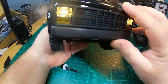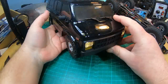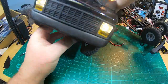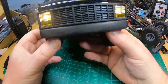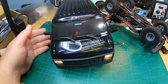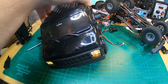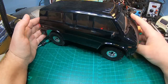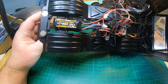And why did I have to do the servo and axle mount? I forgot to tell this to you, because with the servo frame mount, it had extreme bump steer. So as soon as you steered, the body was totally angled. That didn't look well at all. It was extreme, and now no bump steer at all anymore. So that's super nice. And with the servo and the frame, it was really, that way, it was extreme. So that's highly recommended. Okay, that's more or less everything I did to the chassis, and not super difficult. Everyone can do it.